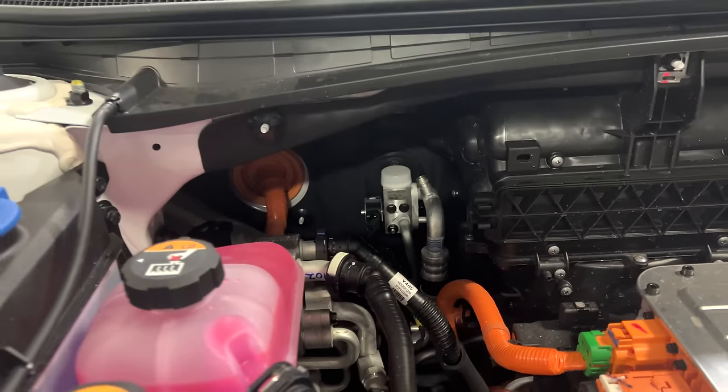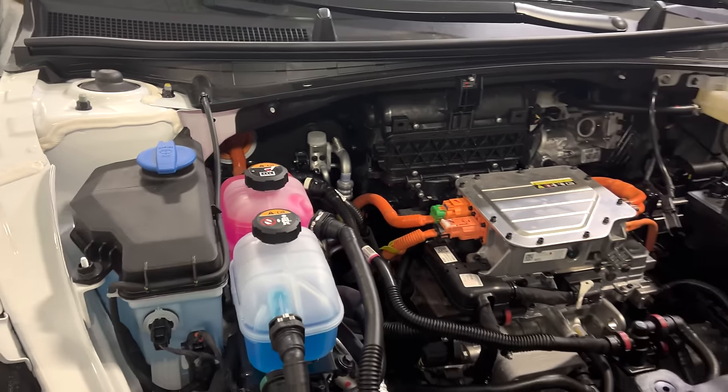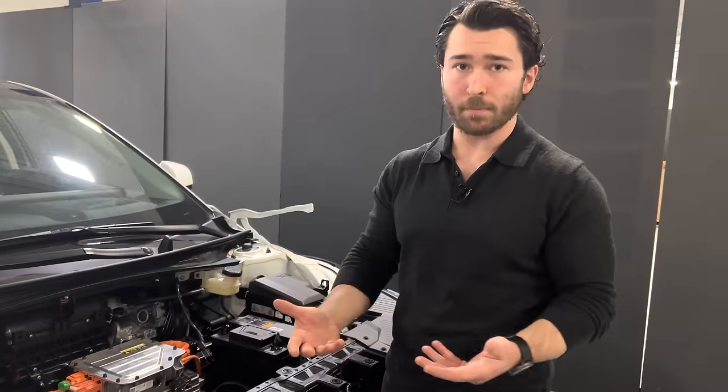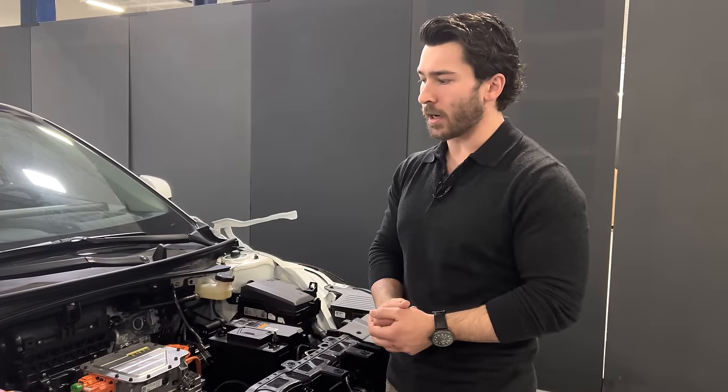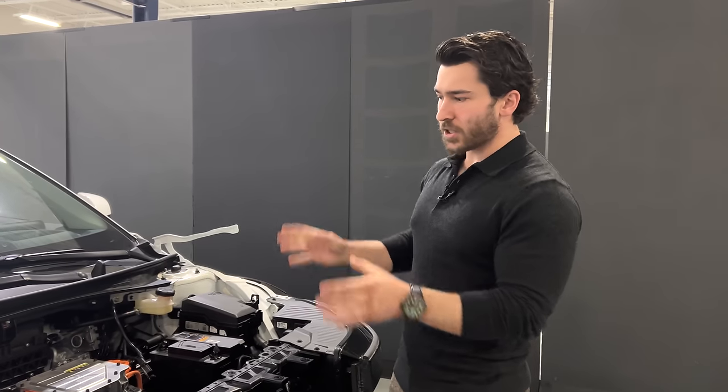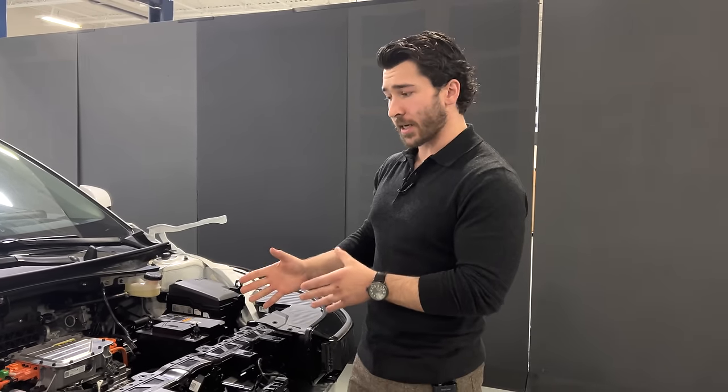However, it's just an interesting thing that they have both the complexity and the components integrated into this design for a heat pump, but then they left some of the equipment and features that you would typically see in a vehicle that doesn't have the heat pump system, all of these additional plate heat exchangers and the integration between the glycol and the refrigerant systems. So that's just a brief overview of what we can determine from the architecture so far.